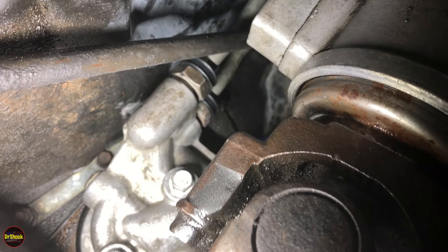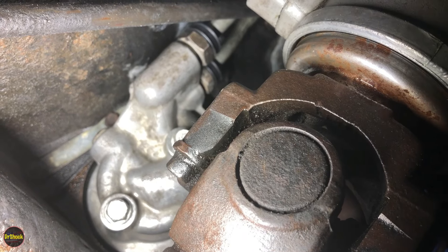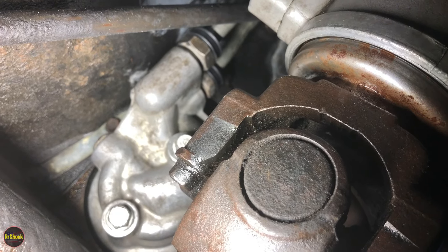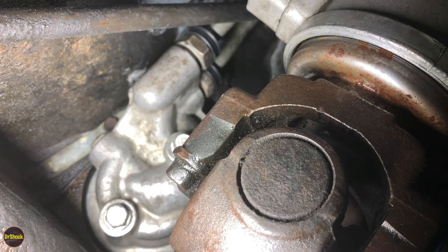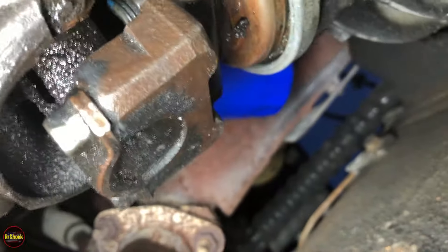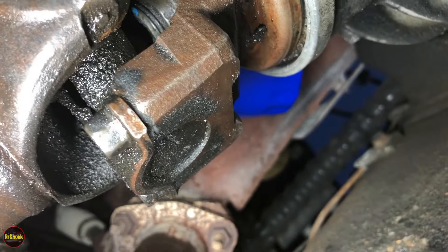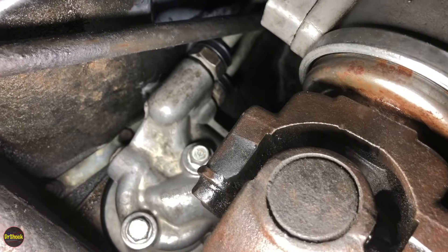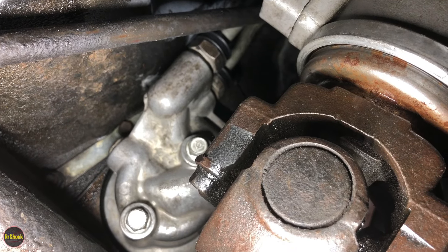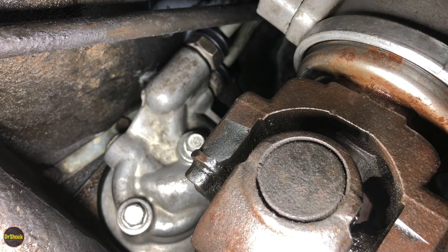That's it — I hope that helped you out in getting this type of job done. We're going to do some cleanup around this area with some brake clean and get all this residual oil leakage out of the way. Hopefully this will fix our problem with this particular leak. We've got a new O-ring, a new seal, the oil filter adapter all cleaned up, and a brand new ACDelco PF52E oil filter. If you've got questions, leave them below. If you found this useful or it saved you some time or money, please hit that like button — it really helps with the discovery of the video.